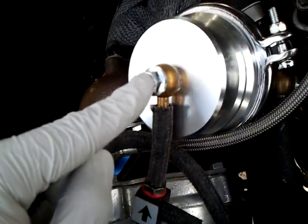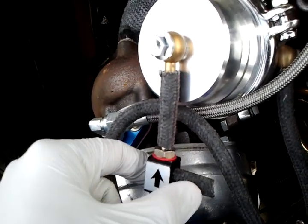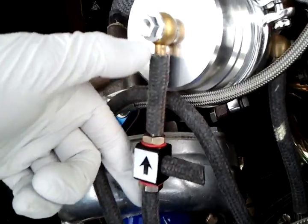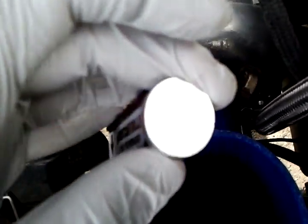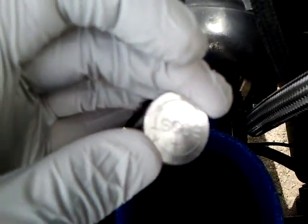After that diaphragm gets pressurized, it relieves it through this valve on the side right here. This is open, and this is a one-way check valve. But then it can go back out the side easily. And it's on the lowest boost setting right now — this way is more, this way is less, and it's all the way less.